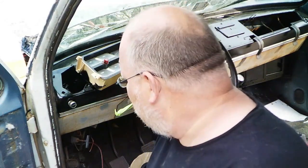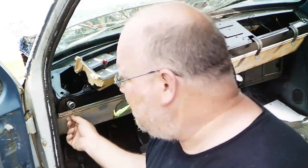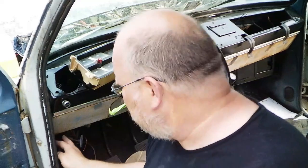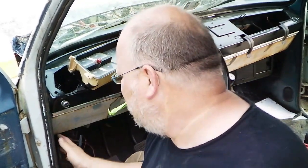I'm going to put a switch right here up under the dash. Find the bracket, paint it black, and I got a rotary switch one time to fix a light that was not savable over 20 years ago. Found it in my electrical bag. What in the devil is that? Found the old switch, decided, you know what, it's a good use of this one. I don't plan on putting any more toggles in the truck. It wouldn't really look out of place in the truck, especially putting it down here with everything painted black. You really won't notice it, but it is a good compromise for switched power and unswitched power. I switch it when I want power.